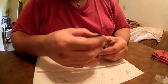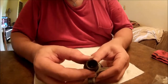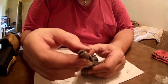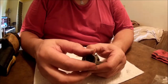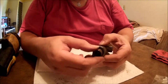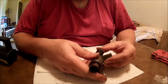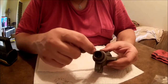The piston will be in the bore down in there — it's got a little cup in the end, and that's where the end of the rod sits. You can sometimes turn it over and tap it and the piston will fall out if your seals are really bad. If not, you need compressed air, because there's no way to grab it with pliers and yank it out if it's down below that lip.